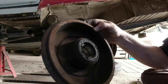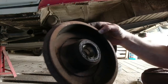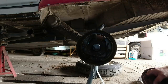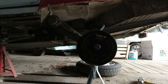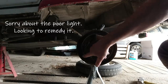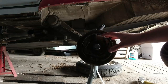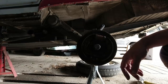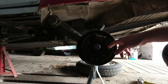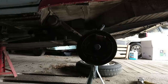Inside the hub here is the wheel bearing, but you've got lock rings and a bearing puller is needed — I'm going to say that isn't a job for me. But that is a horrible looking brake drum — let's get the wire brush out and clean everything up. I've just been chatting to Jono at Peak2CV and he reckons I've got the shoes in wrong — this bit here should be up the top, and similarly on the trailing shoe. I was hoping not to have to disturb the brakes, but I fear I may have to. If things aren't where they should be I'll have to have it apart. This adjuster is very, very sticky — you need your adjusters moving nice and free and easy.